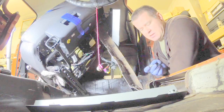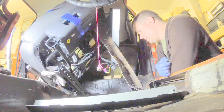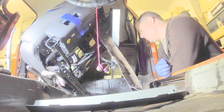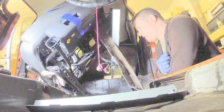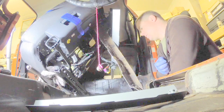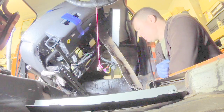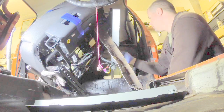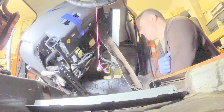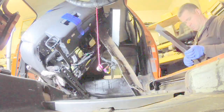The easiest way to fix that is going to be to take a little bit out of the seat rail, make that hole just a little bit larger. The other option is to cut my bracket in the back and then bolt it together, tack it in, and then weld up the gap, which is probably the better way to do it, as opposed to enlarging the seat hole. So I think the next thing I should do is check the passenger or the inside track and see if I screwed that one up.